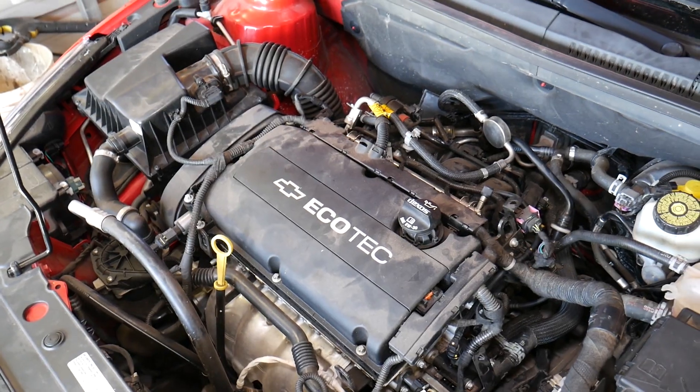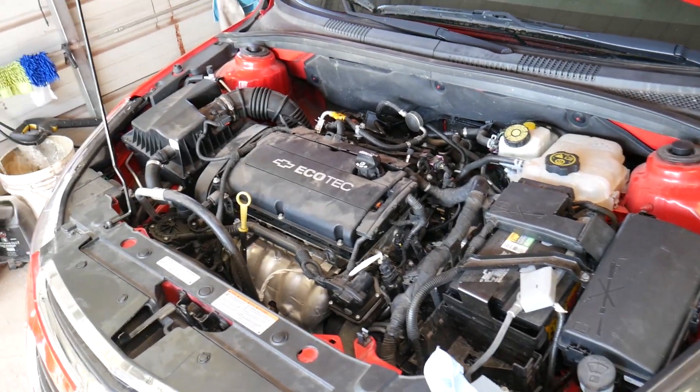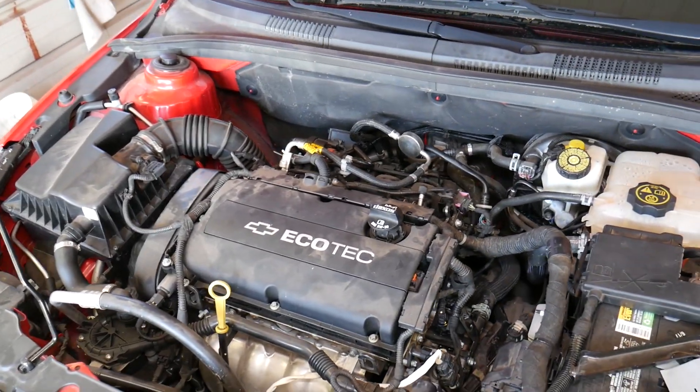The consequences are really terrible — you can develop black smoke, increased oil consumption. If the PCV valve is stuck open you'll be burning oil, you can have rough idle and misfires. We have a whole video that explains the symptoms of a bad PCV valve being stuck open or stuck closed.